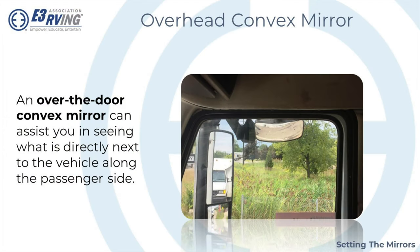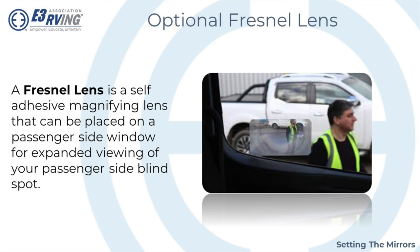If you're having a hard time spotting the traffic directly over the passenger side window, you might add an overhead convex mirror like many of the truckers have, which lets you see directly down next to the vehicle. If that's not an option, you can use a stick-on Fresnel lens, which basically amplifies the view you have in a broad view. You can stick it on the window on the passenger side or in a back window, say in the kitchen area, looking down over that side of the vehicle, eliminating that blind spot directly next to the vehicle.